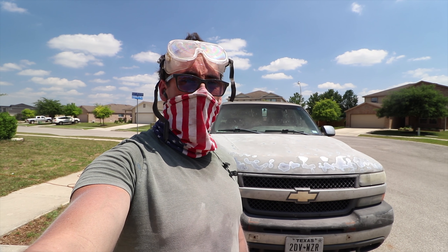You might think I'm a little crazy for sanding down the whole hood, but there are so many rock chips, and if something's worth doing, it's worth doing right. My camera overheated because it's so hot out, so if you're outside doing this, wear some sunscreen — I already burned myself pretty good. I'm going to go to Lowe's because I forgot I don't have any primer. I'm going to get some etching primer and acetone to clean up all the dust and get it ready for paint. Then we're just going to prime a lot of stuff, get the Bondo ready, and do all that fun stuff.